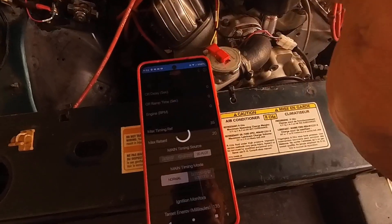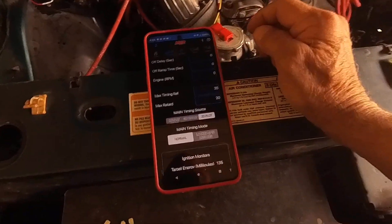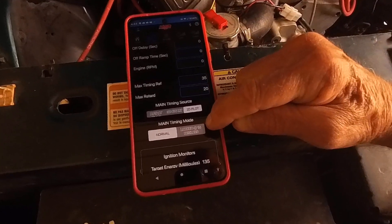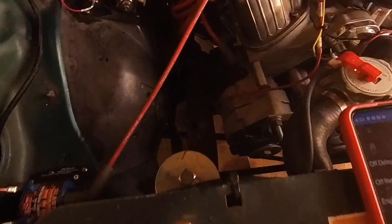— is go to Settings. The only way I got it to work, after playing with it for about a week, was to put it on locked 15 degrees and then actually use the MSD timing light to time it at 15 degrees.